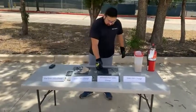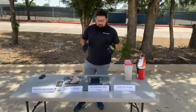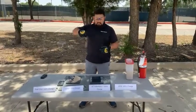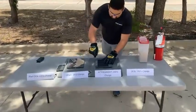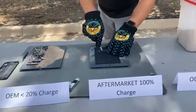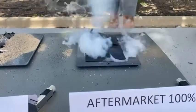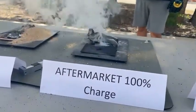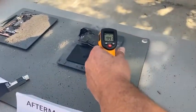This is the finale — the biggest battery we're puncturing today. This is the worst-case scenario, and probably the easiest one for it to happen too, because if you've done an iPad repair, cleaning the frame is an important part of the process, and that involves a blade or a sharp tool around the edges. Slip and hit that battery — it's not good news. I'm going to simulate that here: I'm cleaning my frame, I slipped. Definitely a lot more smoke here — it's hot enough to ignite.